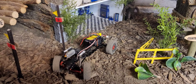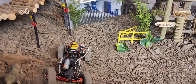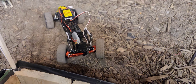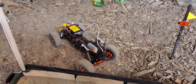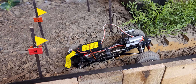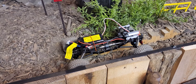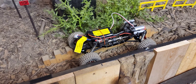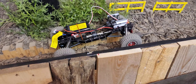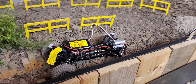It's got overdrive in the front axle. Joshua pre-installed the overdrive gears in the front axle. It's so much more controllable with the Axial electronics. Combined with the worm gears and that divorced transmission in there, that is where you're getting the slow crawl ability.